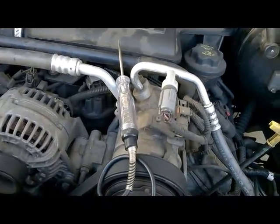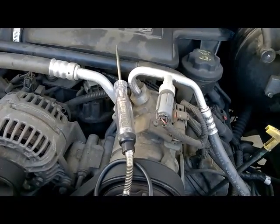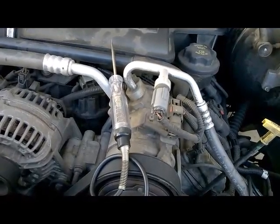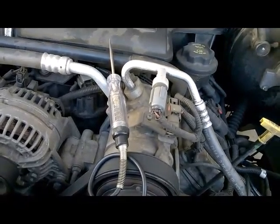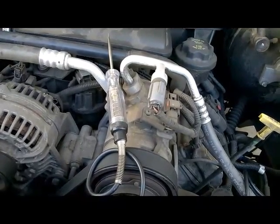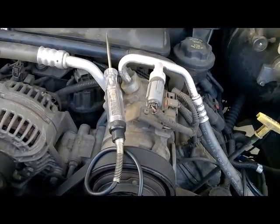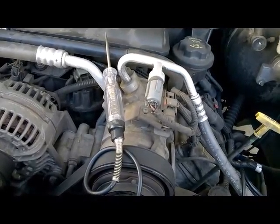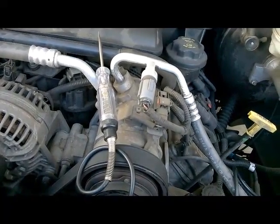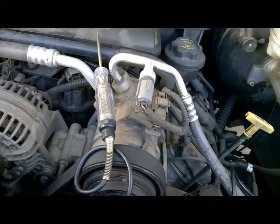Alright, so for those that don't have a scan tool with bidirectional control capabilities, you could actually perform an EGR function test by using a 12-volt battery test light and touching the control wire on and off, either with the key on, engine off, or with the vehicle running. But make sure when you perform this test that you know the circuit design on the control wire of the EGR solenoid.